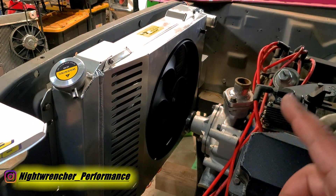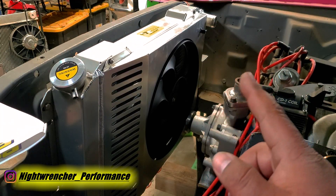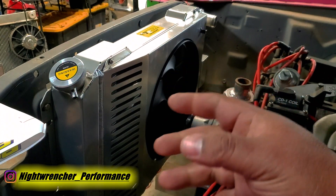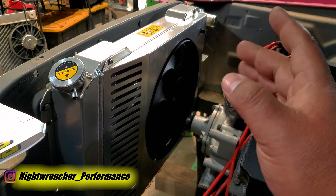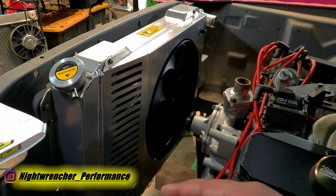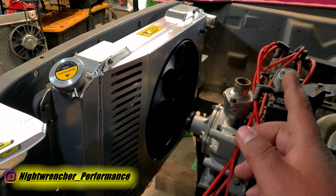The fan did kick on when I wired in the ignition wire, battery wire, and bypass wire along with the ground. I noticed this fan has a slow-start feature which keeps amps from being drawn all at once — some other fans kick on instantaneously, putting a sudden spike against the battery, alternator, and charging system, but this one ramps up as it speeds up instead of pulling all the amps at once. That basically covers the entire installation front to back. In another video I'll get more into the nitty-gritty of how to wire it up, so stay tuned. Night Wrencher signing out.